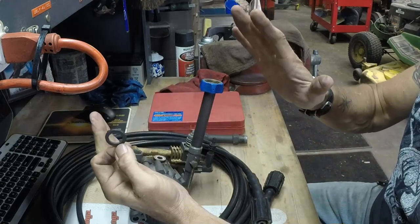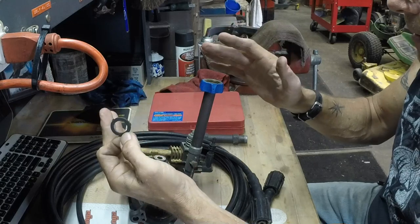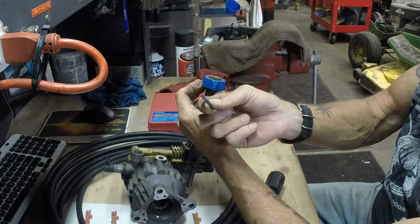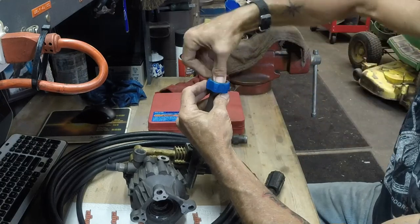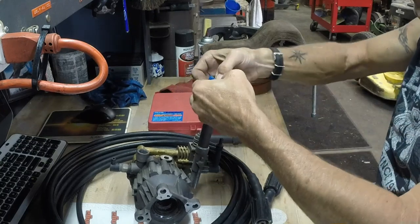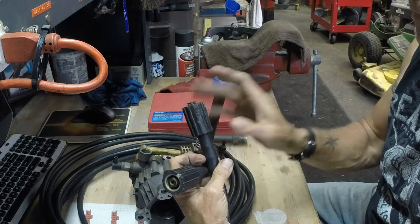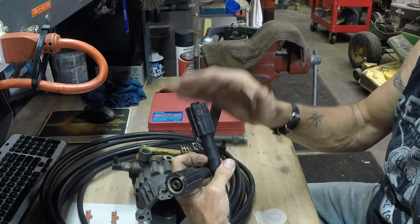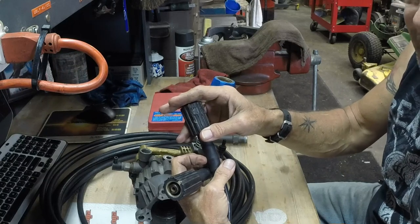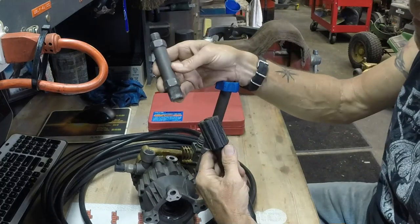You can buy these things in a sheet that's got like a dozen of them on it — you use it a couple or three times, it gets compressed. If you're leaking around here, you grab another one, stick it in there and you're back off to the races with a new gasket and no more leaks. Both ends of these the owner said were leaking like crazy. This one had not been off since he purchased the power washer — I believe it was in 2008. That's nine years that this hose stayed attached to that line.